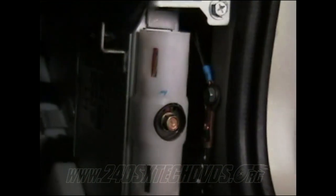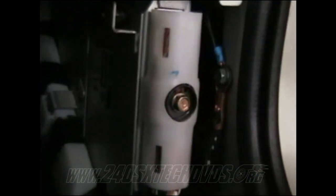They're all 10 millimeter nuts. Put your harness in, tighten it all the way until it gets snug. Don't torque it down, just snug it down. And that's good. Go ahead and put your carpet back around and everything, and put your interior piece on. It just slides on there, and then you get the plastic nut that bolts to that bolt back there. The plastic nut will go over that nut there and holds it down.